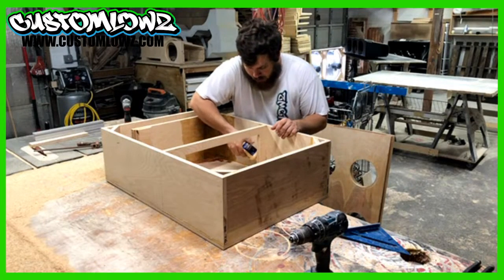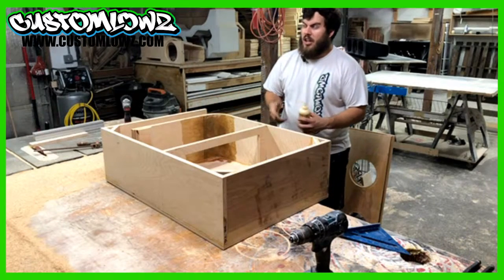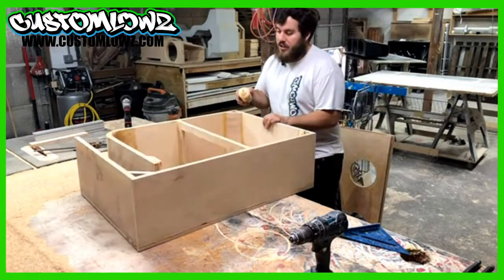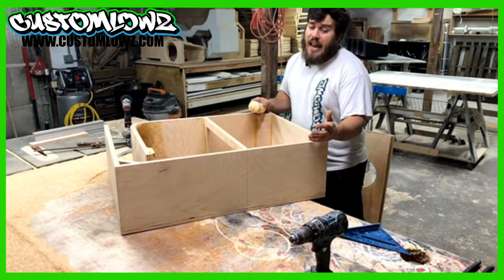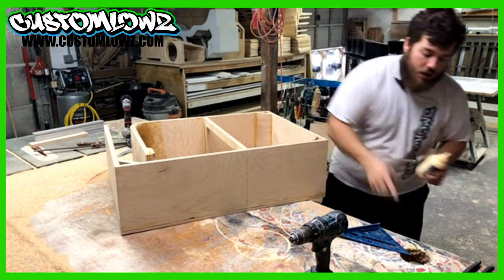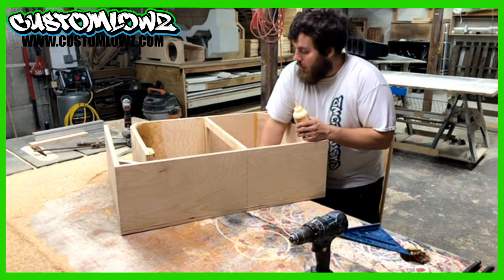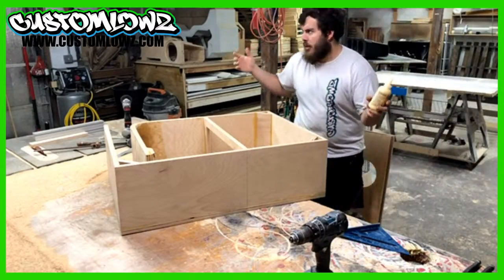Like under seat enclosures, you really run into that situation a lot of times. Most under seat boxes are going to be around 2.7 cubes on the inside, underneath like the Chevy Silverado. Now 4 X8s sound great in that box. But if you did the math, the X8s would really want almost 3.5 to 4 cubes for 4 subs. And you might think, oh, it's not going to sound good. It doesn't got enough space. But because it's a shared chamber, you get away with running a slightly smaller enclosure. I don't know specifically why, but I just know it works, and I keep repeating it. If it works for me, I just repeat it until it stops working for me.